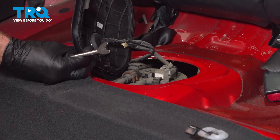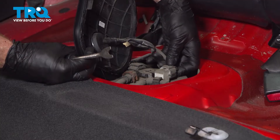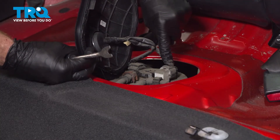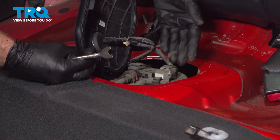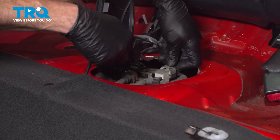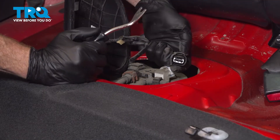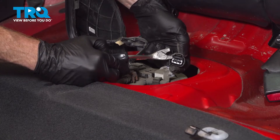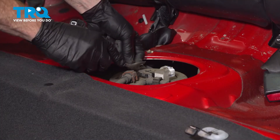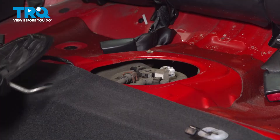Once you're under this area, it's time to start disconnecting the electrical connectors — there's two of them. To disconnect the first one, press in on the locking tab directly along the top and slide it out of place. Once you have it disconnected, do a quick inspection for corrosion and set that aside. Continue on doing the same thing to the next one. Locking tabs along the top on the second one as well — easy to see and easy to remove. Set this aside.